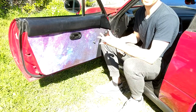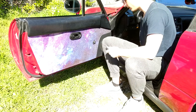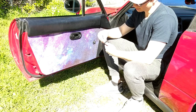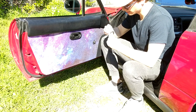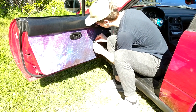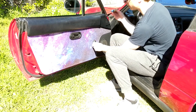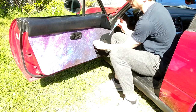Now we're going to do the door crank. Take the trim piece and place it on here. Then take this clip, put it partially on so it's sitting in those little groove things. Now that it's part of the way on, place it on here and then take a flathead and just press it in. There you go — now the door crank does not come off.